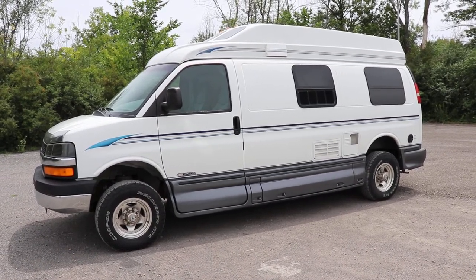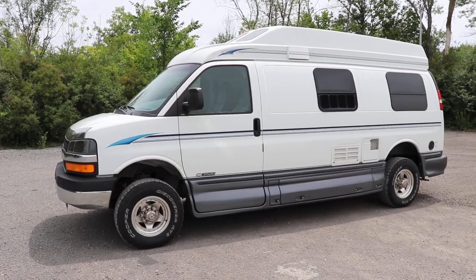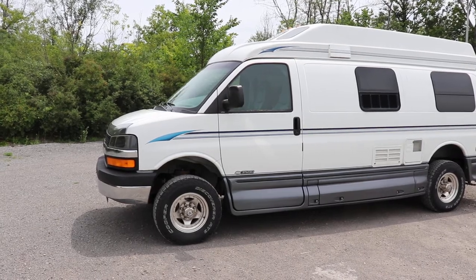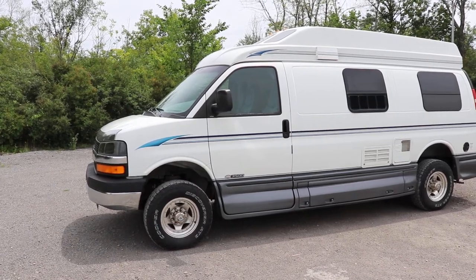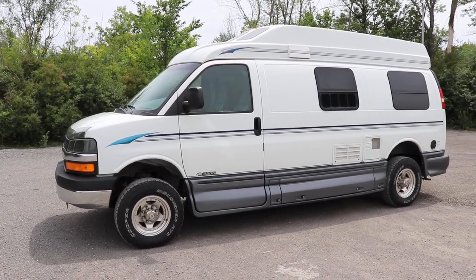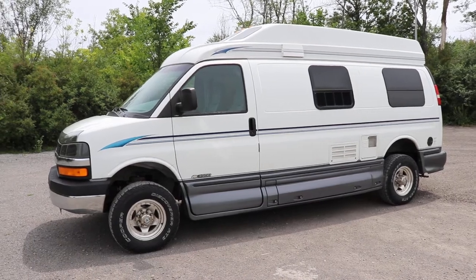I've been very happy with it. I had some struggles initially that I determined were not a problem with the lift kit itself. I had problems with death wobble — the steering shaking very badly. The lift kit definitely activated that problem more than before, but the problem was the front brake pads and rotors. You need to run semi-metallic pads on this van, and I've had the death wobble with no lift on it. So it wasn't a tire problem, wasn't a suspension problem — it's a brake problem, and that other video goes into it in more depth.